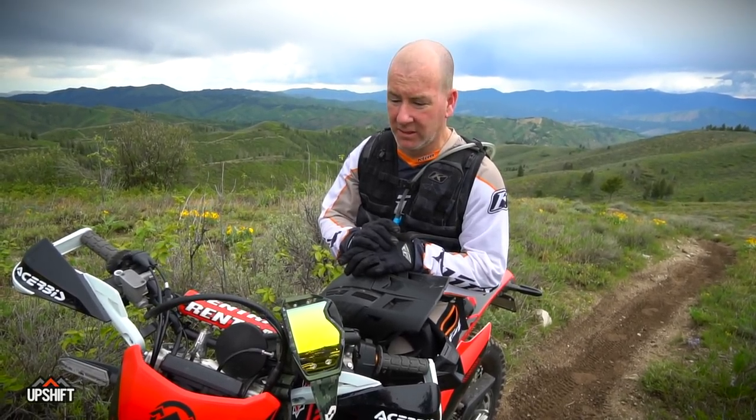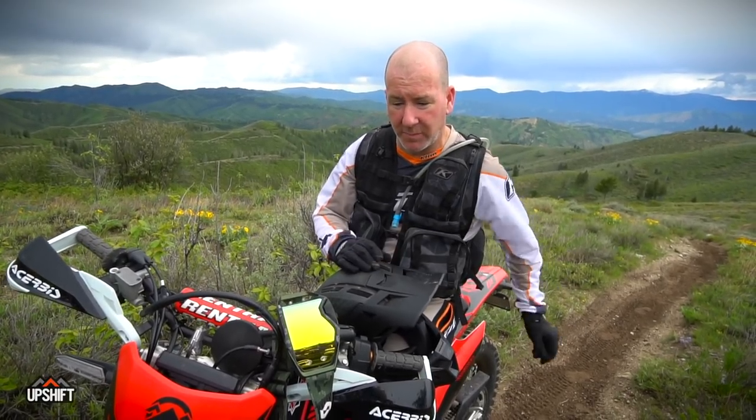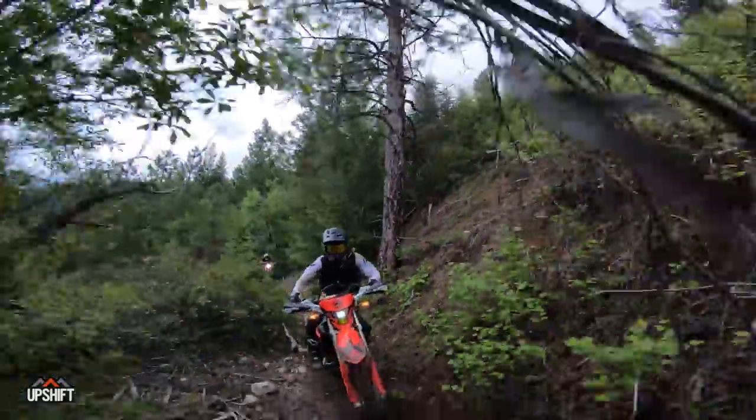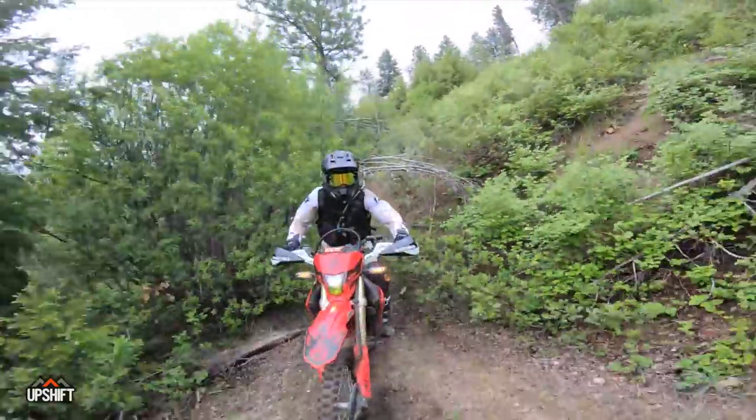Another benefit, and you're gonna get sick of me on these videos talking about tire pressure and tire choice before you talk about suspension settings, because that is the last contact between you and your bike to the ground. But this has the tubeless system in it, which is really great, because on the back, I'm down to about 8 PSI, and that Shinko's a really big tire. So it has a lot of absorption. It's not really the ideal pressure for hauling ass and sliding in corners and tire roll, but for riding single track and getting full traction on slippery rocks and all that, it works really well.